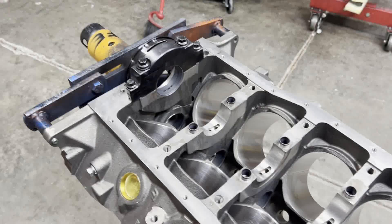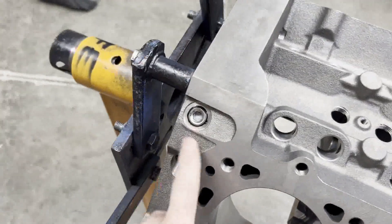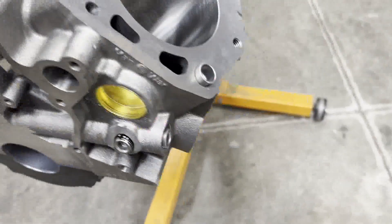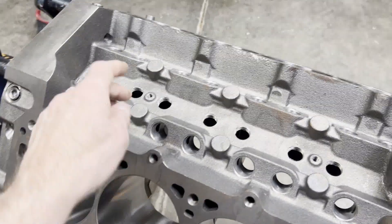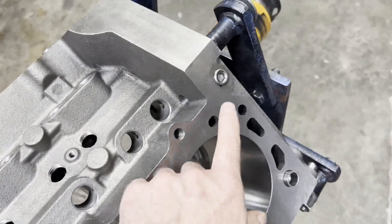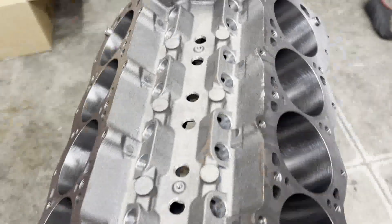Let me roll it over and show you the top end. There are lots of extra feeds for dry sump applications — you can feed to the port in the back or through this port here, so there are several ways of going about it. I drilled and tapped these holes, and depending on where the head sits in relation to this fitting will determine whether I plug these or put a short standoff pipe in there.